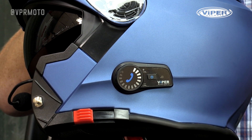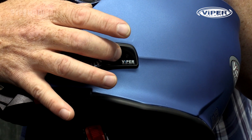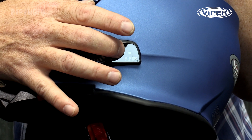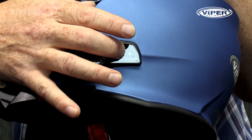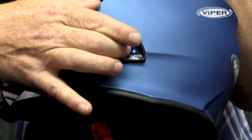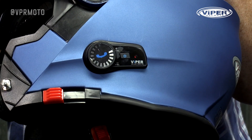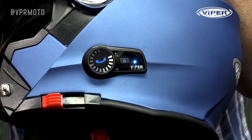Let's have a look to see how easy it is to pair this up. There's a smaller button just behind it which is used for pairing the helmet and turning it on. Viper have told me that by just holding the button in for a few seconds we'll get power, and if we hold it in a bit longer until we see a red and a blue light flashing, the helmet's now in pairing mode. Then go to your phone, put it into discovery mode and search — a line should come up that says Viper Bluetooth Helmet. Press on it and within a couple of seconds your helmet should be paired up.